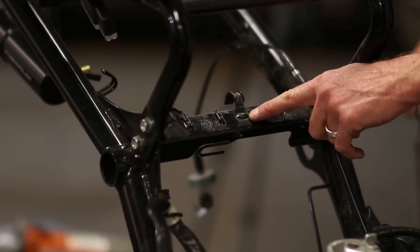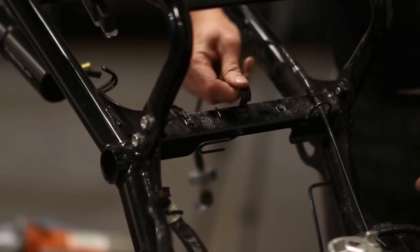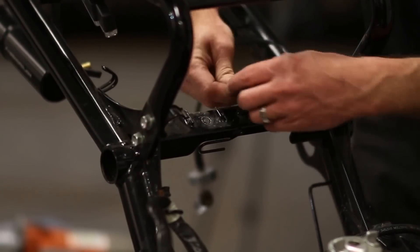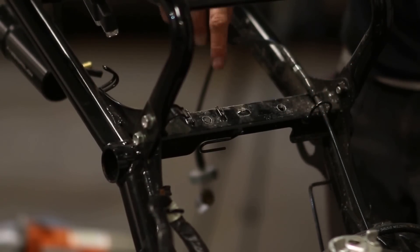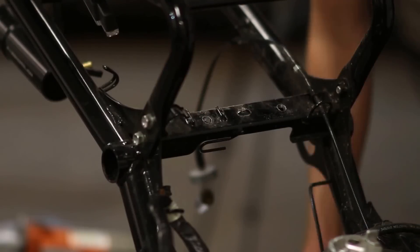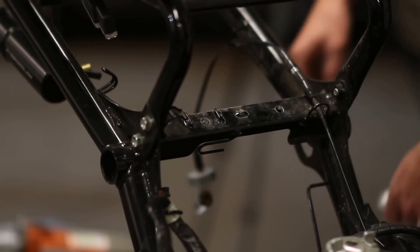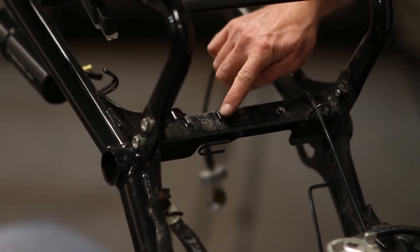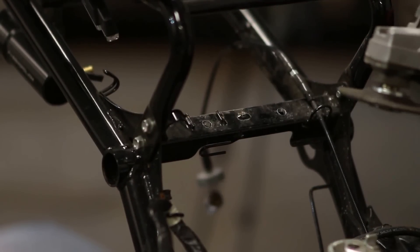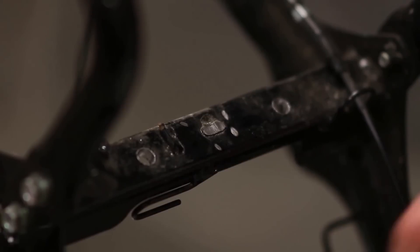There are a few things we'll have to grind off. We're going to grind off this tab here. I'll just go back and forth with it to make it easy, and these guys too — I just bent that off. We're going to smooth out that weld and get these out of the way so that when we put this plate on, it's flat. Right now it's not flat. I'm going to grind off these welds — make sure you wear protective eyewear. You've got your gas tank right down below, so make sure that's empty and safe so you're not going to cause an explosion.